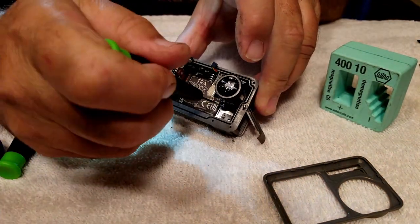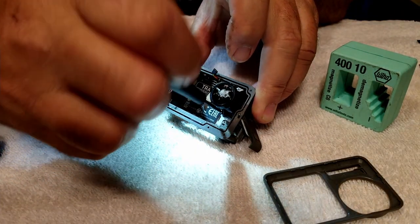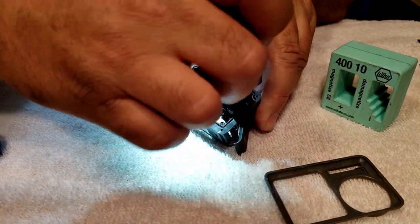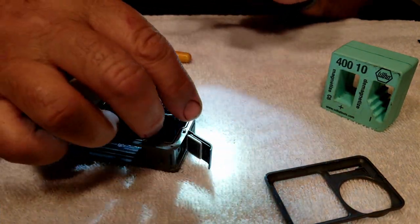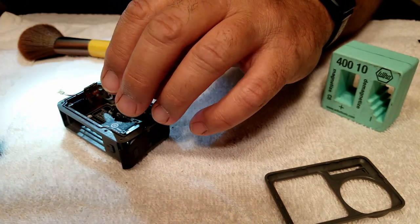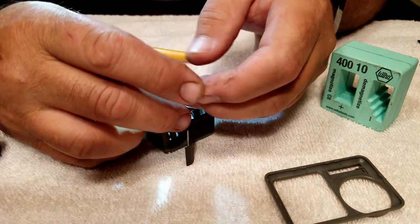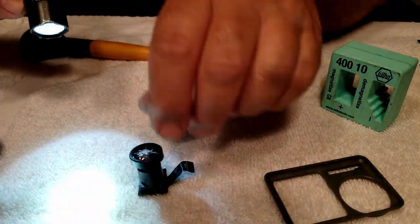Now I'm ready to release the last three screws holding in the camera lens — all of this disassembly has been just to get to this part right here. I have no idea how the fisheye part of the lens got busted while the protective cover was not. If you have any ideas, leave a comment below — I don't know if this was just internal stresses or what, because the case is warped and damaged but you'd think it would also damage the lens cover. I've got one more ribbon cable to disconnect from the tape, and here we go — the lens is out.